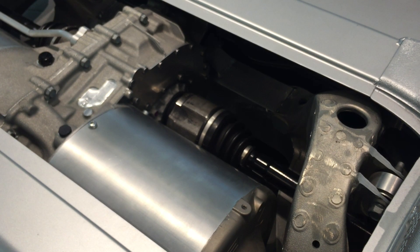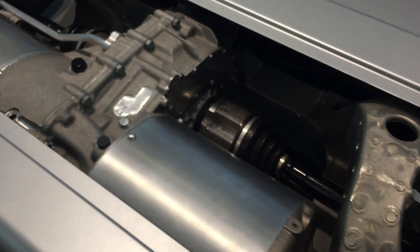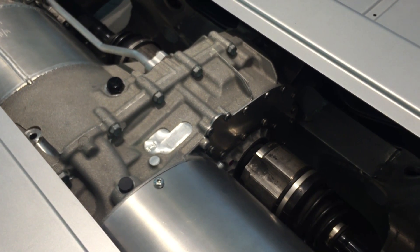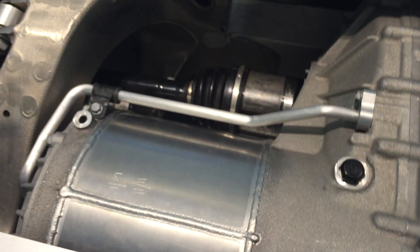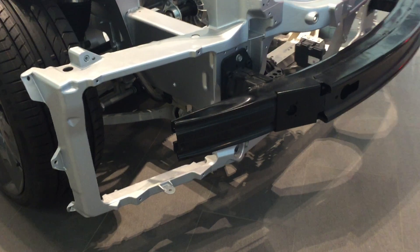Here are more details of the drivetrain between the rear wheels. On one side you see the drive inverter in the silver case; moving over, there's the one-speed transmission gear reduction drive; and on the other side is the three-phase induction AC motor — I used my hand for scale. The rear motor can put out anywhere from 328 horsepower to 532 horsepower for vehicles equipped with Ludicrous Mode.